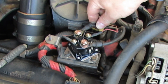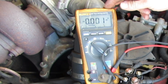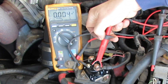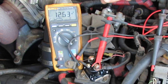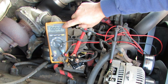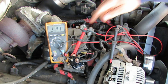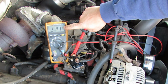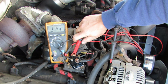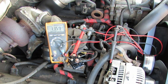When we turn the ignition on, we should see this line that goes to the wiring harness for the valve covers get power when the key is cycled. I've got my meter set to volts DC, my ground clamp on the alternator housing, and my positive lead on this terminal first. This comes right off the battery so I'm getting 12.63 volts - that's good. Now I'll put it on this terminal, cycle the key, and we should see this voltage go up during the glow plug cycle. You can see the glow plugs are actually on right now and I'm getting 11.48 volts - I've got some other things drawing power. Coming in at 11.6 volts on the input side, so there's a little bit of voltage drop across this relay, which is totally fine.